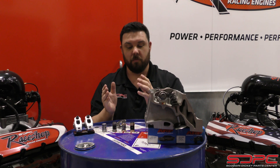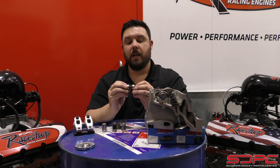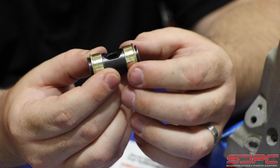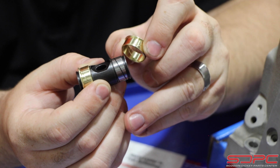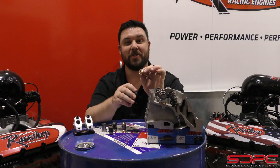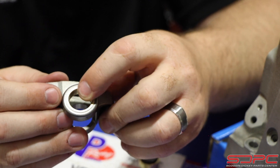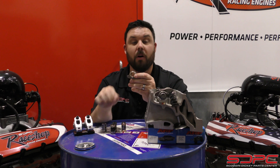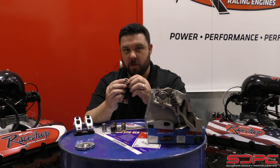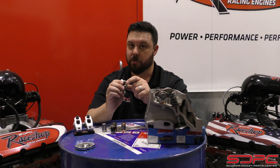Now you're probably wondering what's the point of the CHE and what's the difference. The CHE takes this one step further — it's also a bronze bushing style trunnion upgrade using a high-quality hardened steel trunnion body with spiral oil grooves. But you'll notice there are also spiral oil grooves on the outside, because this does not press into the rocker body. You don't need a press to install them — these are a full-floating bushing. Not only does the bushing ride on the trunnion, the rocker arm body also rides on the bushing. These are for the real high-end race guys — autocross, road racing, or very high RPMs. This is probably your last step before some real trick custom rocker arms.